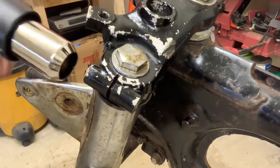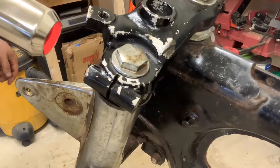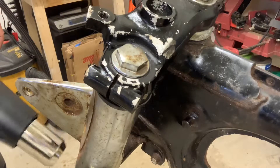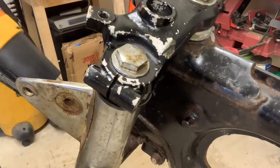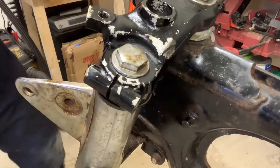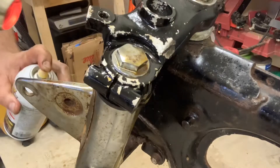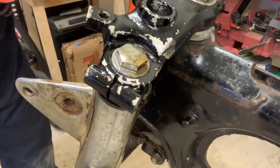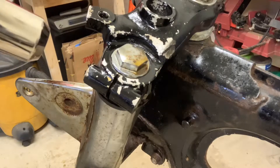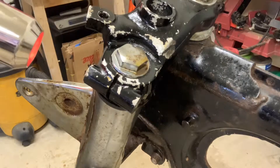So the first thing I did is I just heated the hell out of these brackets. I've literally spent like three minutes just heating these up — the outer aluminum bracket. And then I went down to the bottom and tried to heat up the triple tree as much as I possibly could. I'm going to keep doing that. I'm going to heat it up and while I'm heating it up, I'm going to keep hitting it with PB Blaster, because this whole unit has got to come out. And as you can see from that previous one, they're roached on there. I couldn't believe how hard I had to fight this thing.